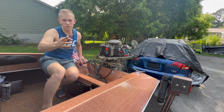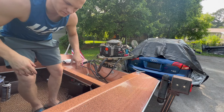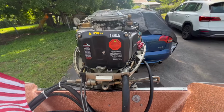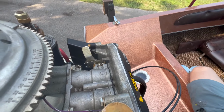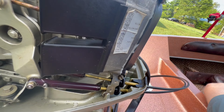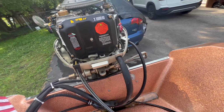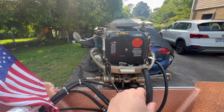Yeah, so let me show you what I'm talking about. Exactly why you would have a gasket here. And he's playing like he never heard of a gasket there. So here is exactly what I'm trying to say. Top side here, you can see that it actually welded up really nice. These sides right here, you can see that there's a pretty decent gap there. So, this thing doesn't sit that flush. Whatever's supposed to take up that room is a gasket. But, like I said, gasket.